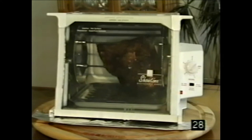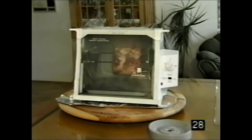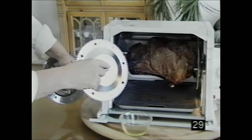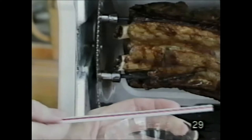Problem: you can see or smell smoke because food is hitting or coming too close to the heating element. This can happen if you don't center the food properly, load it properly, trim off excess fat, or if your food is too large. Here's an example of a roast not loaded properly — it catches on the heating element and burns. Always check on your food from time to time. If you hear a squeak as the machine turns, put a drop or two of vegetable oil or olive oil on the gear wheel nub before inserting the spit rod assembly, or use the end of a kebab rod dipped in oil dropped onto the nub as the machine turns — or even a straw. Be careful when the machine is turning, as these parts get very hot.